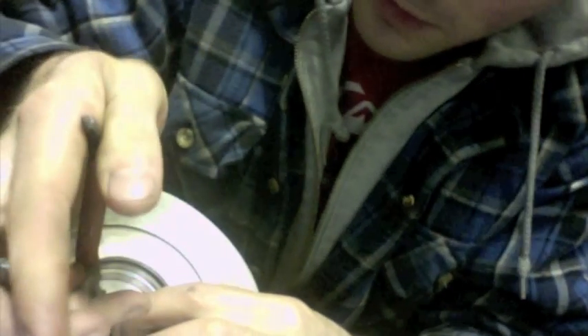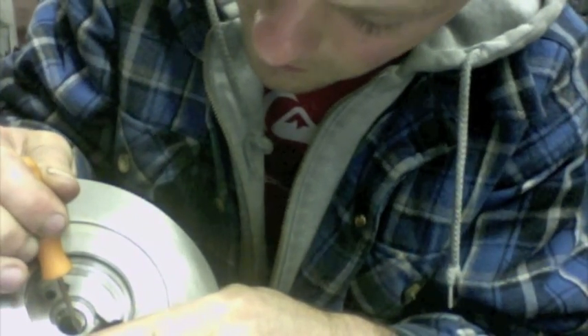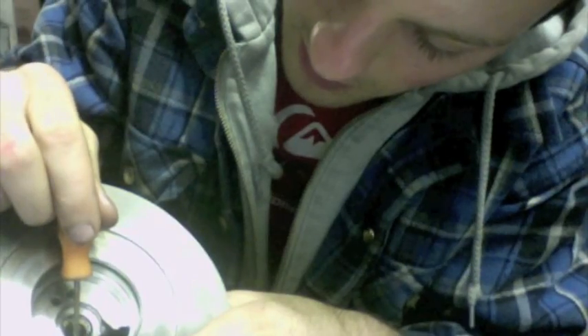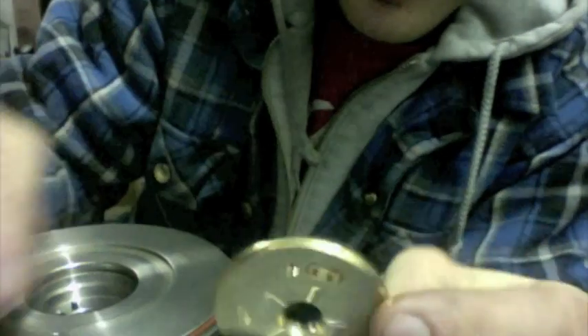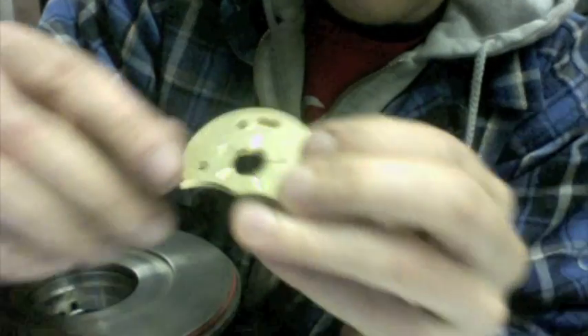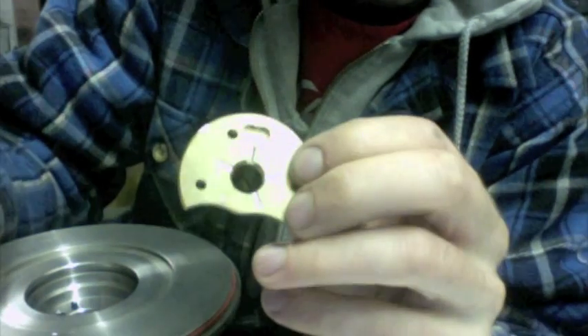Hold that with your finger and grab the two holes. One of the most important parts is to make sure that it goes in all the way. Sometimes you will have to go back and pull the clip back to make sure that it didn't go too far down. Then go ahead and install the thrust bearing. One thing to note is that on a lot of aftermarket thrust bearings the holes are not large enough, but I was able to get aftermarket kits that supply thrust bearing holes that are the proper size, so we don't have a problem with thrust bearing failures.